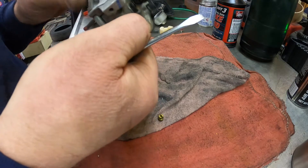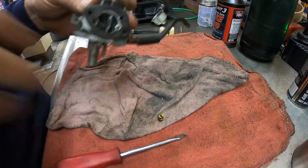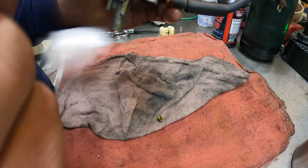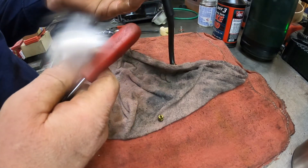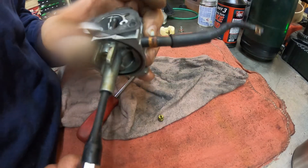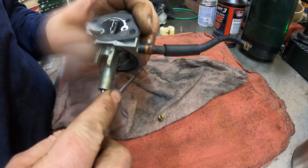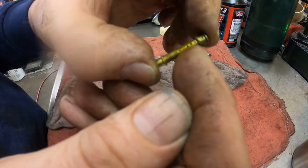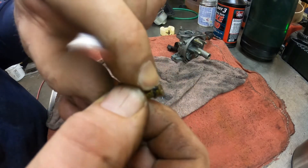There is an emulsion tube in there which we'll try to get out next. This is really gummed up, so I'll spray a little gum cutter up in here and take my screwdriver up through the carburetor and push it. It did push down. I'll use the pocket screwdriver — push it back and forth and there it comes. Here is the emulsion tube. There are little holes here and I can already see that one's open, that one's clogged, that one's clogged, that one's clogged — and look at the big piece of gum right there.